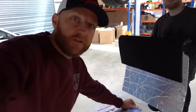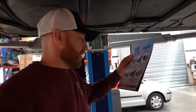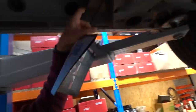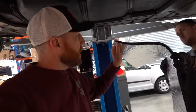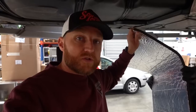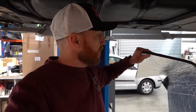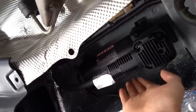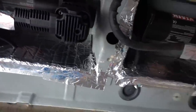The plan is to use the Sound Stopper MLV, which is 15mm thick and is a four-layer soundproofing product in one. The plan is to put as much of it as we can around the compressors and up on the underside of the engine tray. There's no right or wrong way to fit it — it's double-sided with two layers of foam, a layer of vinyl in the middle, and a silver back. We're fitting it foam side in, silver side out to protect from the elements. We've added some of the Sound Stopper around the compressors — in hindsight it would have been better fitted before the compressors were installed, but we've done what we can, and after this we'll do a sound test.